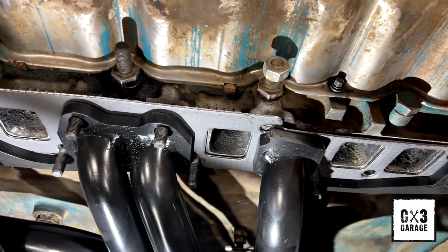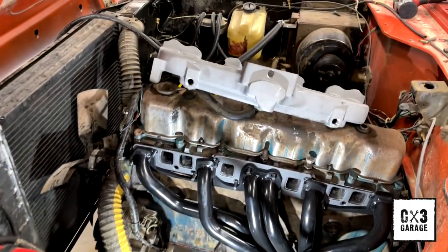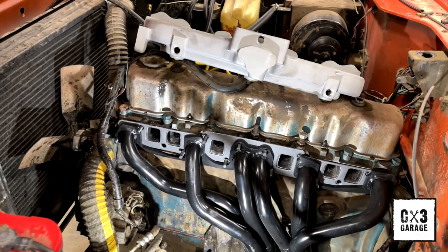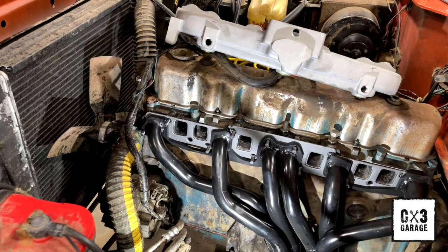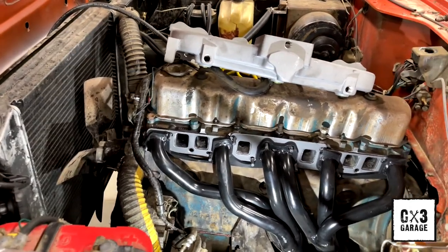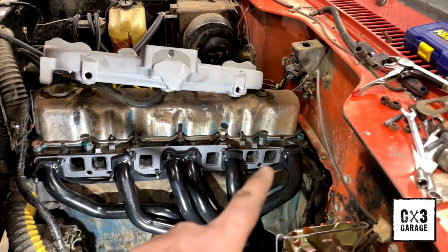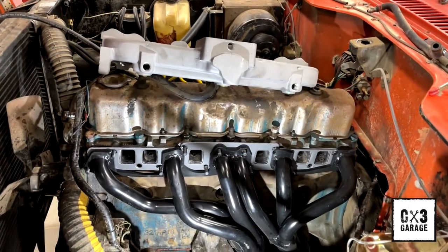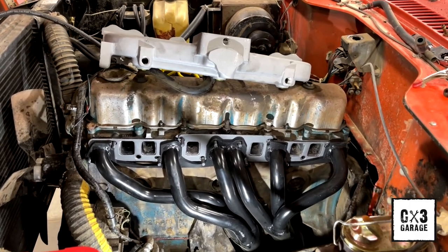Not a big deal. This would take a guy with a rat tail file maybe half an hour, and that's pushing it. So if you're intimidated by that, you don't need air tools. So far, I've used no power tools minus my drill to clean up the head surface. You don't have to go buy an air compressor just to have a carbide bit. You can take a rat tail file and just work that out and get that opened up. But unfortunately, that opens up a little more can of worms than I want to tackle tonight.